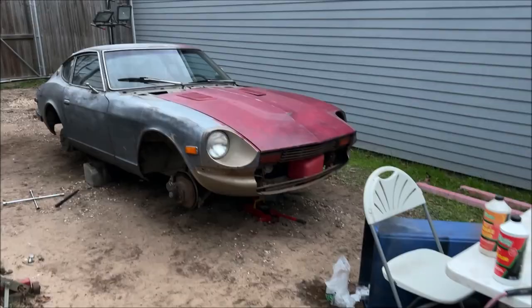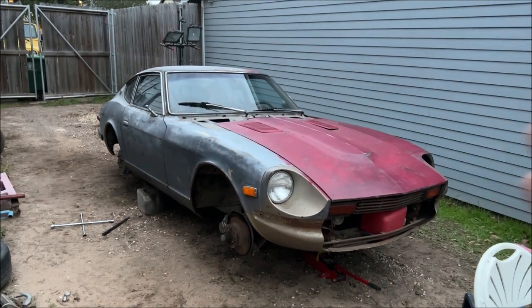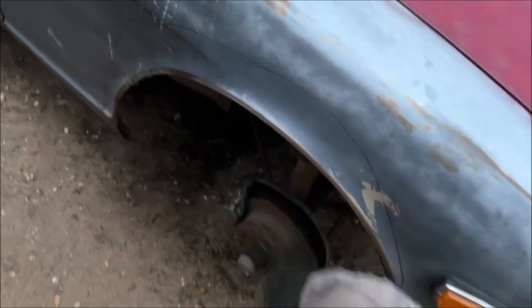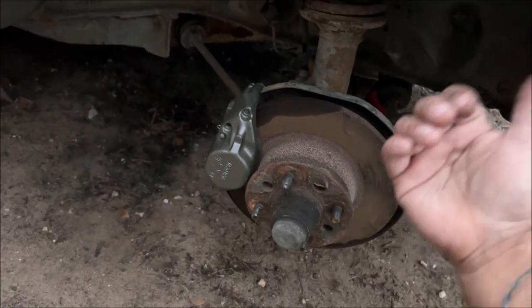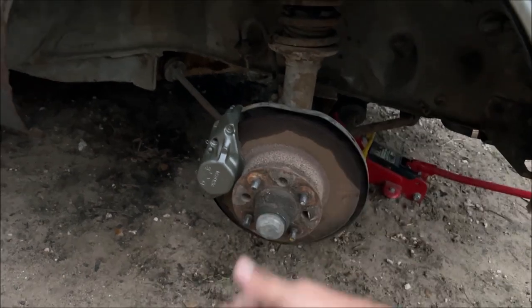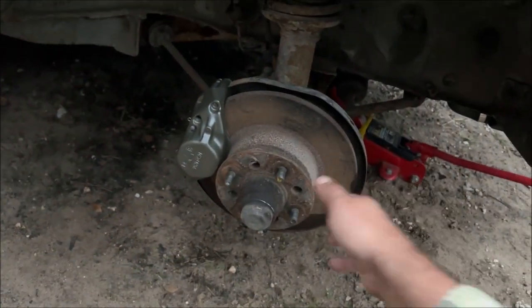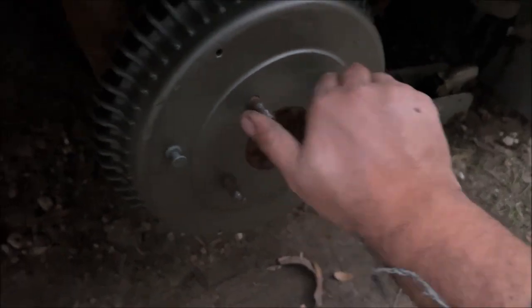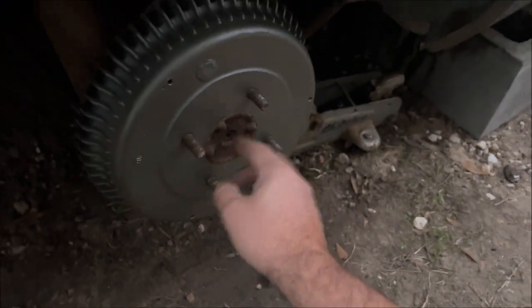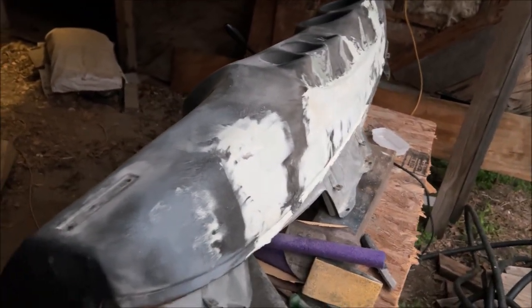My third week of vacation is officially up — I have to go back to work tomorrow. Time goes by way too fast when I'm working on it. We got the brakes all done — nice. Why didn't I clean the rotors up? Nobody wants to machine rotors anymore. There's an O'Reilly two or three blocks away; there was a mechanic shop I used to take brake parts to — he charged me $15 each and loved doing it. I'm not going to buy new rotors when these are perfectly smooth. One thing I'm noticing is that the wheels are not hub-centric — it's lug-centric. The drum is hub-centric. We fiberglass-resined all the cracks in the dash, sealed them up, and the cover goes over it — should turn out real nice.